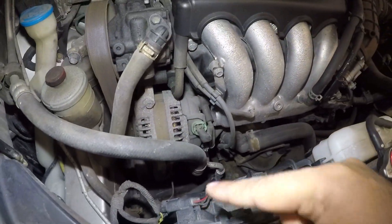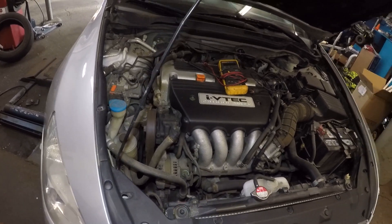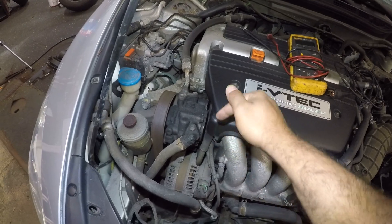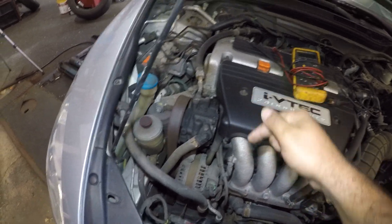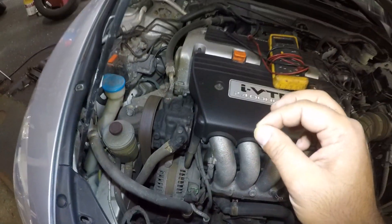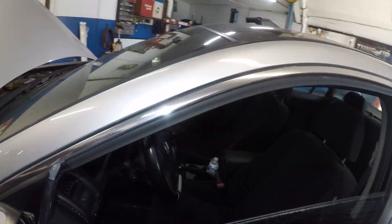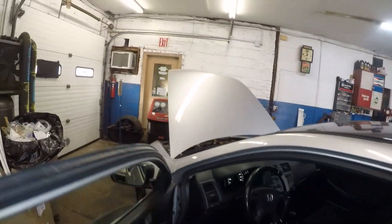This one has only one wire. If you have a Honda Civic, you're going to see three wires, and the wires come all the way over here — there's a smaller connector. The wire that's red is going to be the same wire. The red has to have power when your AC is running. I'm going to go inside the car, start the engine, and put the AC on.